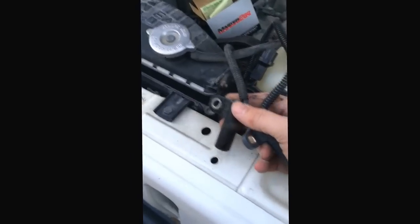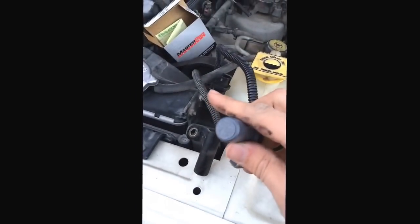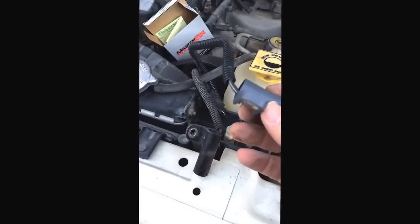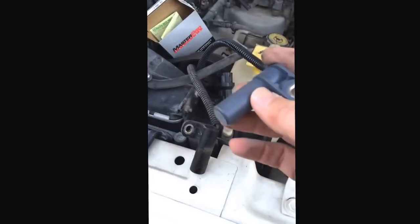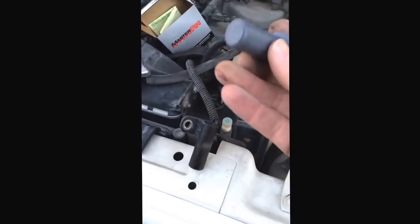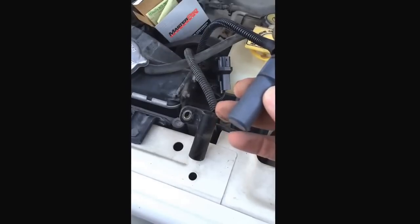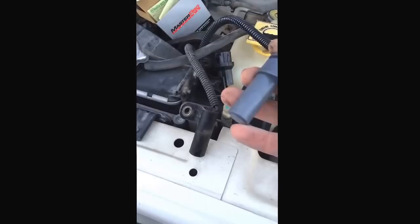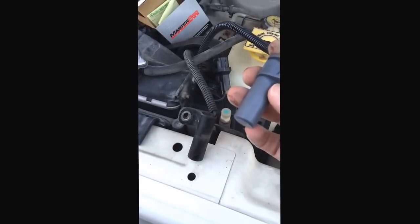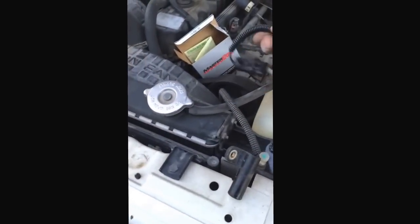It just sticks right in there. There's no seal, though some of them I saw in the videos had seals on them. This one doesn't. There is a small piece of felt right here in the end, which the instructions said was a spacer and to not peel it off. If yours didn't come with those instructions, don't do that. They said when the engine started up, it would get sheared off. And if you ever took it out, make sure that you put a spacer back in there, because you're going to need it. So go ahead and bolt that back in there. There's a little wiggle room here for the bolt. It self-adjusts, then crank it down tight, and that spacer will keep it in the right place. So go back under, put this bad boy back in.